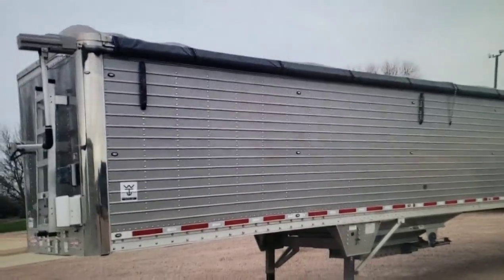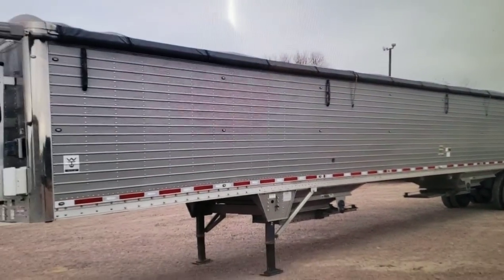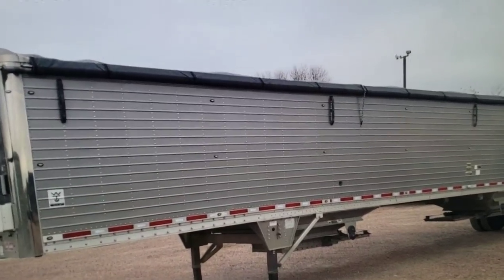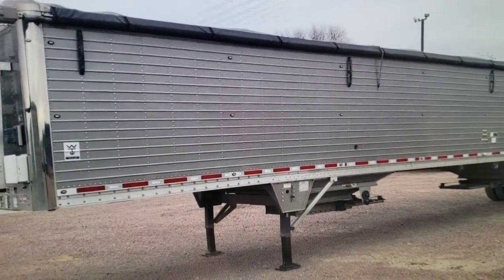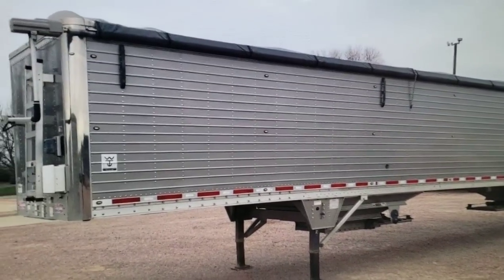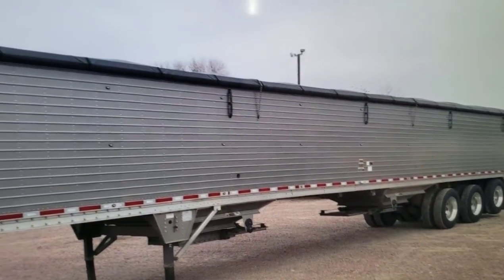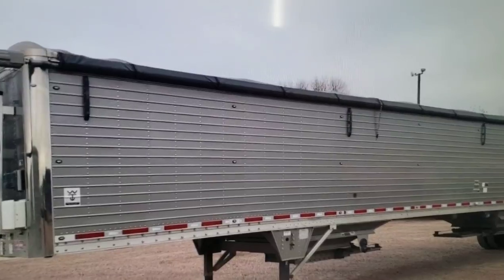I've been considering looking at a hopper bottom trailer and been talking to Wilson Manufacturing about it. That's what we'd want - a Wilson, they're actually made just northwest in Sioux City, Iowa. It's a pretty nice trailer. The Wilson rep says that you can go up to 16,000 pounds on your front axle when hauling commodities if you have a qualifying axle - like a 20K front axle truck with four-and-a-quarter wide tires or 385s. That would be nice because then you could haul triple axle in the rear of the truck - 16K in front axle, you'd be about 100,000 pound payload.